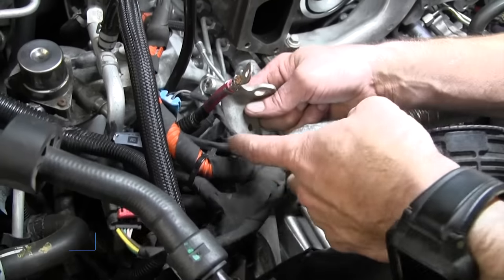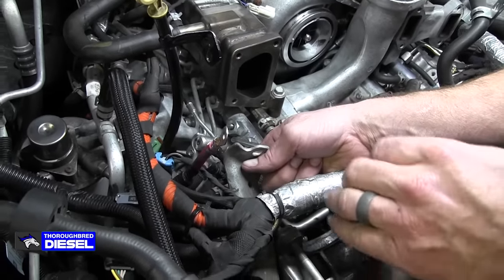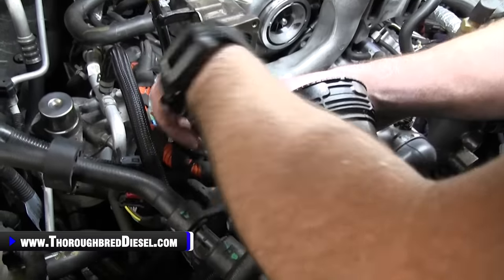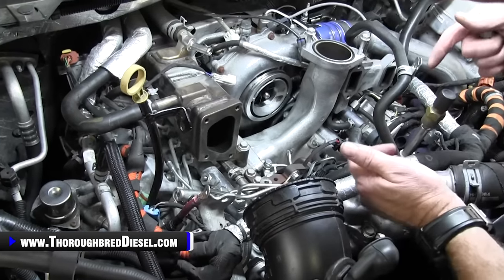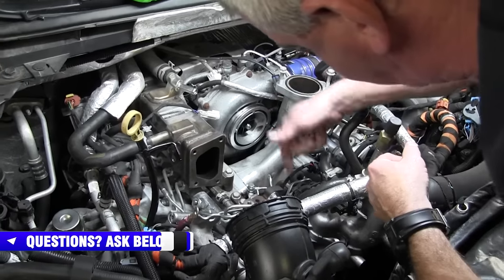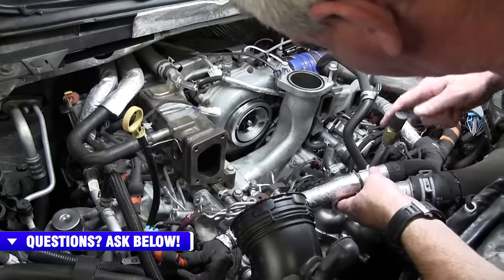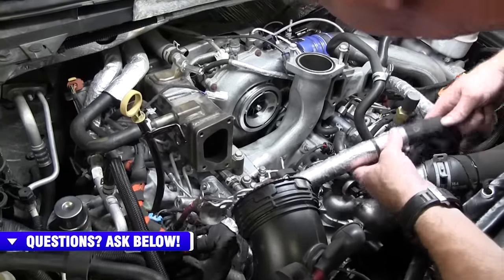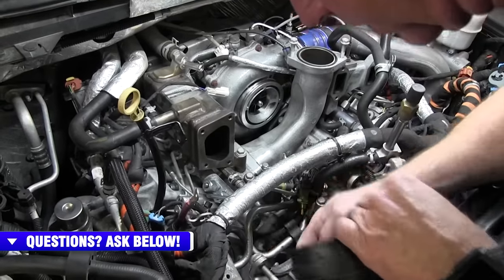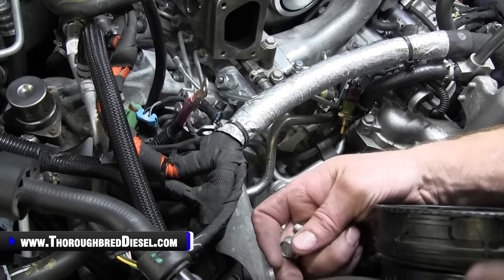It's got a couple of holes in it for the wiring harnesses to attach back to, your main wiring harness as well as your wiring harness that comes from your alternator. But you want to make sure, if you did like I did, after you take the CP4 out, I just took this wiring loom and laid it over the vacuum test port. You're gonna wanna loop that back over before you put it back into this standard. So the two 13 metric bolts go right here. I'll go ahead and bolt it down.